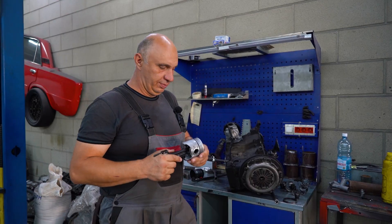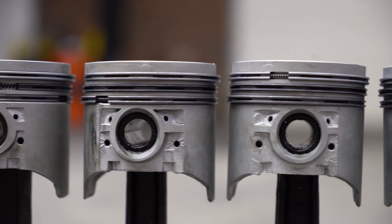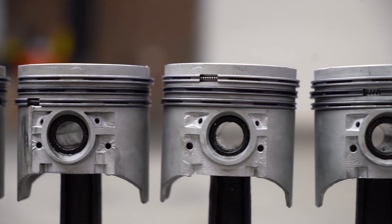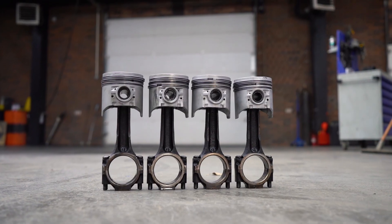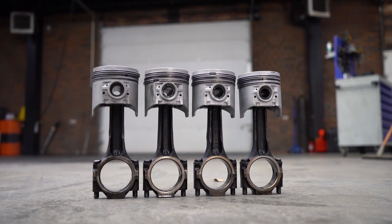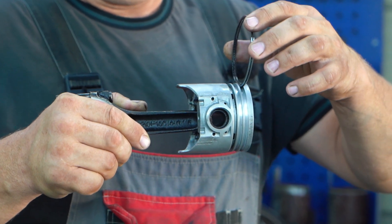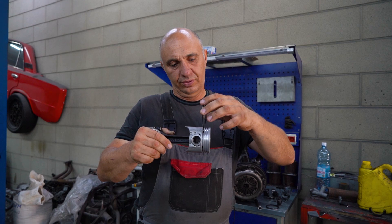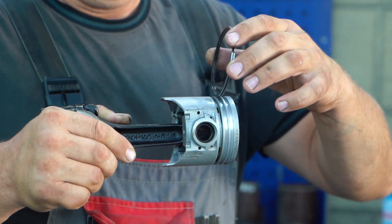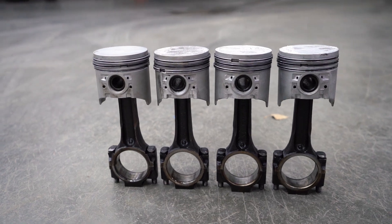We have machined all three grooves in each piston. And once again, we are not going to be drilling them, so that we maintain compression — it'll all be going down to ring number one. Here are all of the grooves. The rings are an excellent fit — very nice indeed. We'll see where we end up later; let's continue.